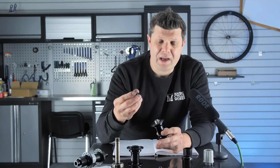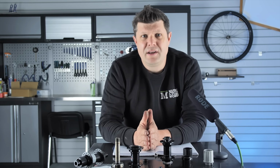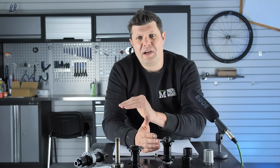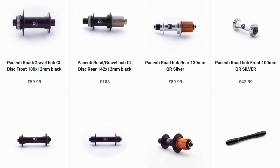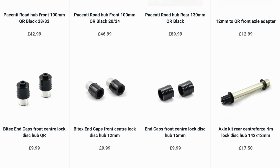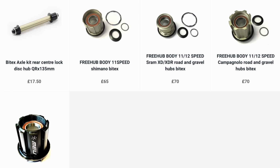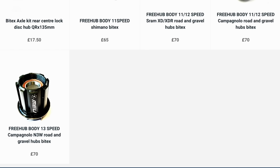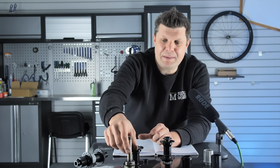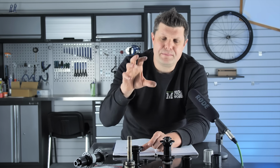You just need a little bit of time and follow a video that you'll find on YouTube, and I'm sure you'll get the hang of them. So to conclude this little section then, first thing you need to do when you're looking for a set of wheels on that wheel brand website is check: have they got parts listed for their hub? Not just a freehub body, but have they got things like axles and spacers and pawls and pawl springs and end cap adapters and ratchets? Can you easily find them, access them, buy them?